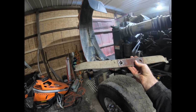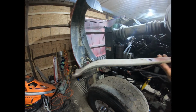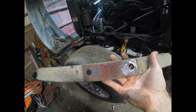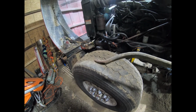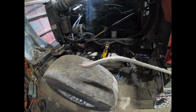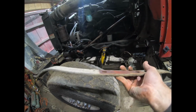Here is that goofy spring, I call it, because it's like an upside down leaf spring. It's got a deal like that on both ends. It just bolts to the top of the transmission on the back. And then these ears set on two ears that are bolted to the inside of the frame rails. You may or may not have that on yours. If it's not there, somebody probably just said to hell with putting it back on. I think it's in your best interest to have that.